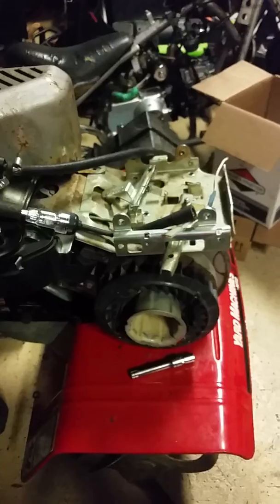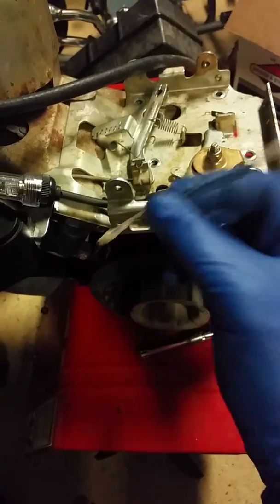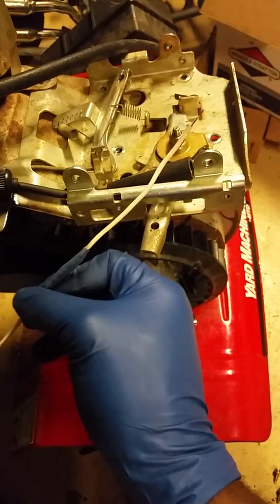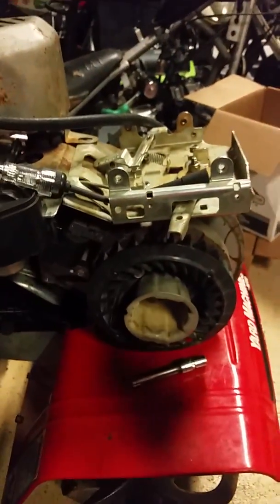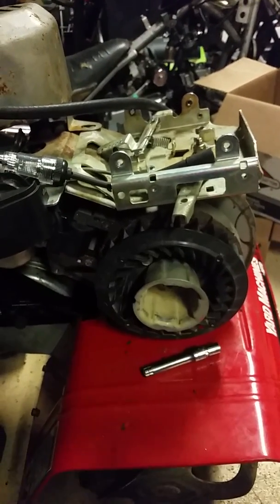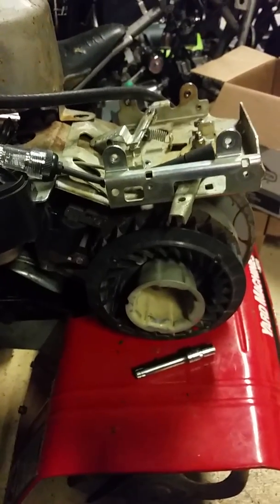Assembly is self-explanatory — hopefully you took pictures. Simply reconnect the kill wire back into the back of the armature, bring it up behind and underneath the mounts, and up under the bracket back into position, and you're all good. I was looking for content on this particular engine but couldn't really find it, so hopefully this helps you guys out. Like, comment, subscribe, and share.